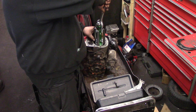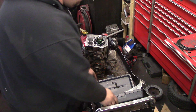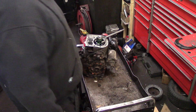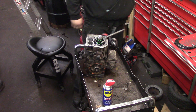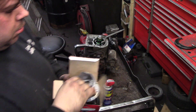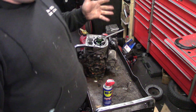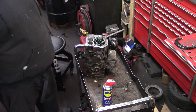All right, place it in here like this. Now I've already took a few thousandths out of it. I may or may not bore the whole thing on screen — that's for the bigger cylinder bores, the Lyle 1500. Not much machine shops around anymore, so I'm going to give it a shot myself. I did find a Briggs & Stratton genuine piston — you can probably read that, 10-over. Now this is a 3-7/16ths bore, which is 3-inch and 437-thousandths. So we want to go 3-inch 447-thousandths.